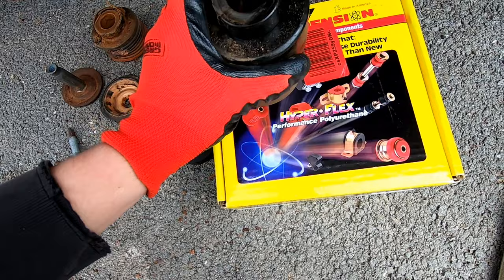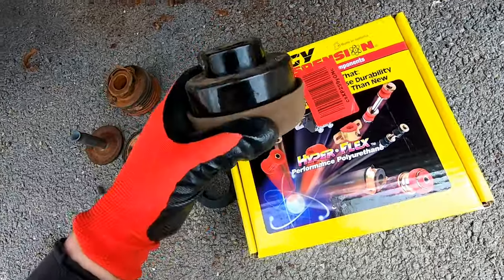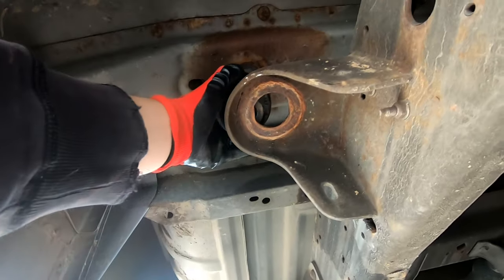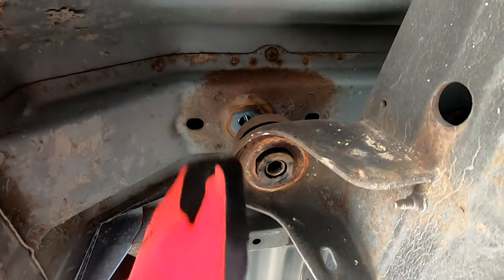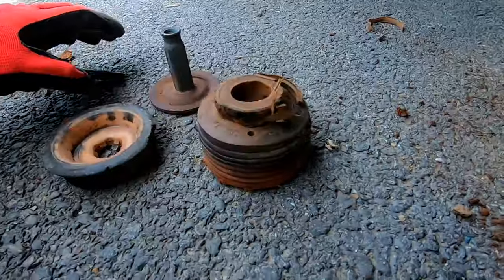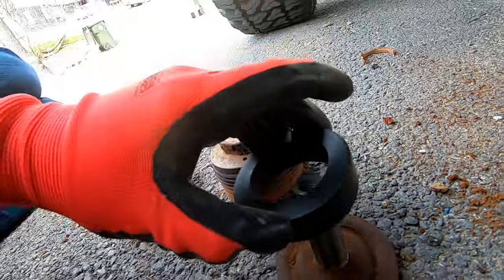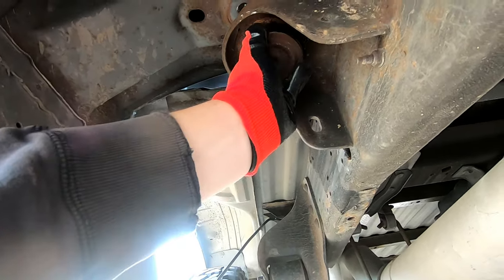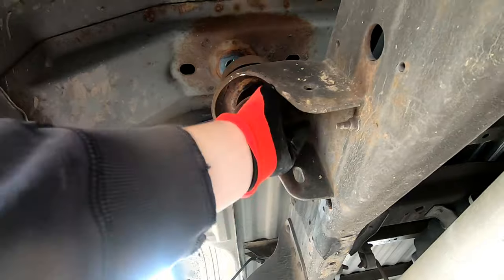You want to take your upper cap and upper mount and just push that down onto there. Once you have your new bushing in here — it's actually shaped like an oval in the frame cutout — it'll just drop in there. The Energy Suspension ones fit really nicely. For the bottom coupler, it has a side with lettering and numbering on it — put that side down — and that will go straight up through there and all fits together very nicely. Then you'll just run your bolt through there.